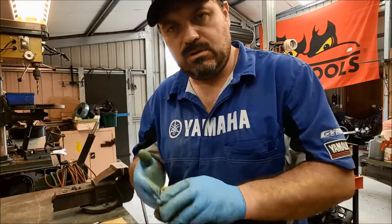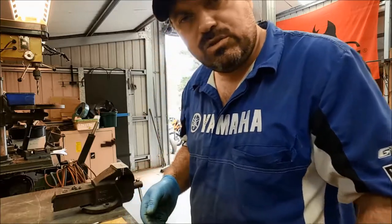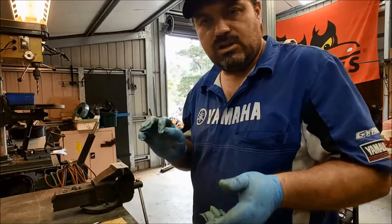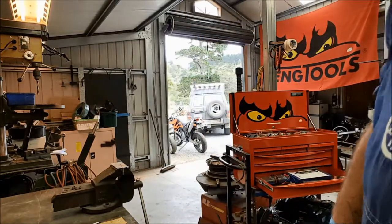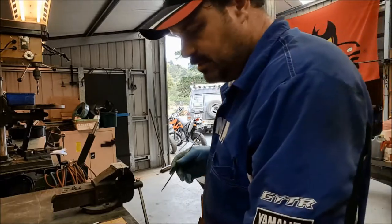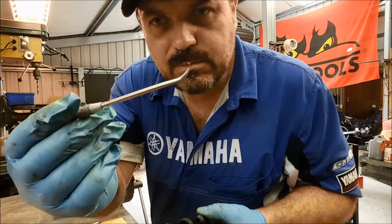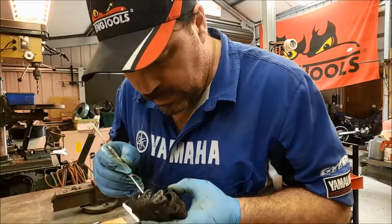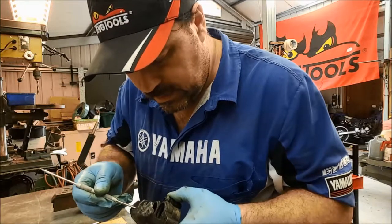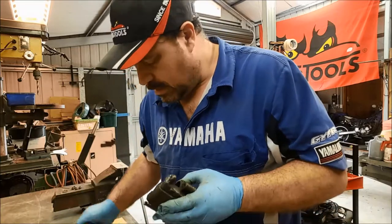The same would happen if you're going to put new seals in there. You've got to flick the old ones out and clean that groove, make sure it's spotless. So to do that, I'm going to use a scriber, a little pointy stick, very carefully. I don't want to damage the seals. So we'll use one of those, little tiny pointy thing, very useful. Just to work our way down the back of the seal, and we can just rotate it round. And there we go, look, hook the seal out. So that's one main seal.